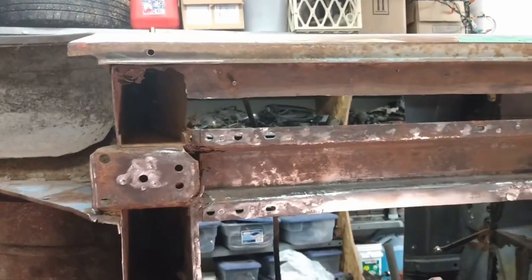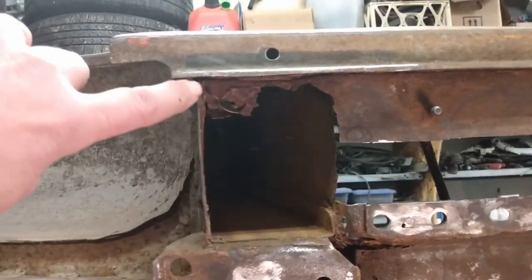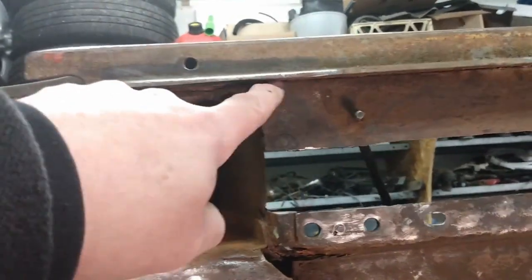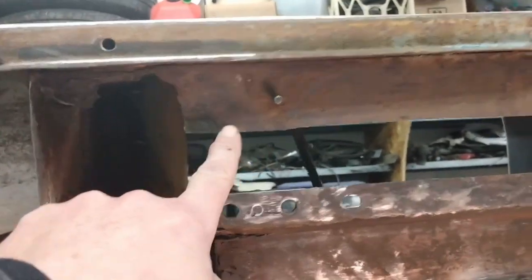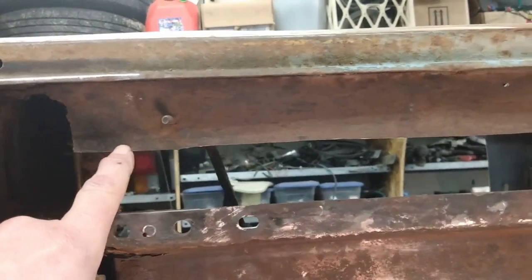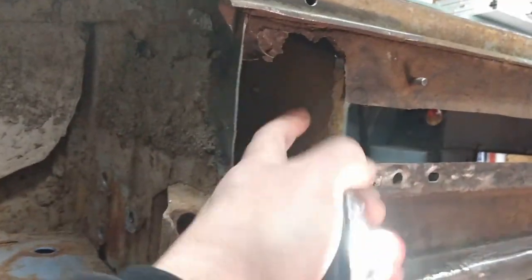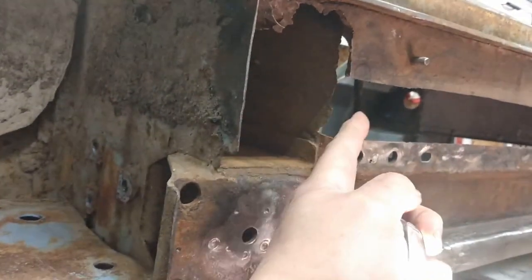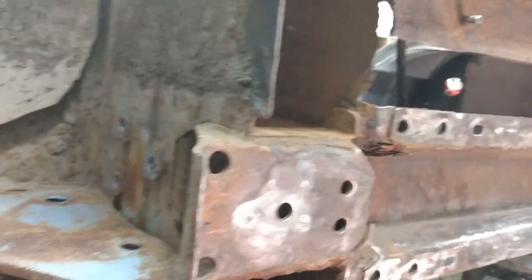The goal this week is to at least start putting the floor pan back on. I'm going to start off with cleaning up this spot over here, because I'm going to have to come in with the floor pan all the way up to this edge here, at least to about here, and then I'll drop down. My plan is to just flange this area here. I will have to put a bit of a patch here, as you can see it's welded out, so I'll just cut up to here and weld it around with a lip on it and then come over it down to there, and that should fix that up.